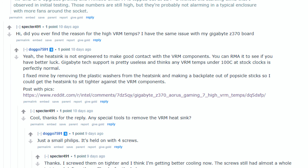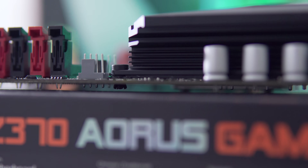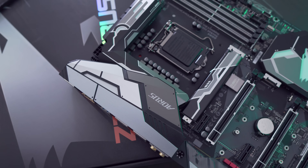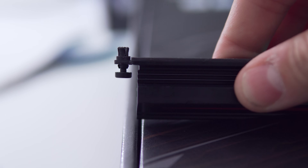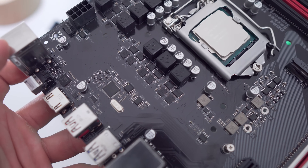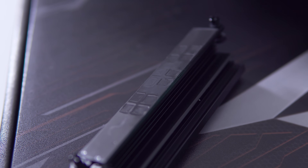I'll link that discussion thread in the description below, but the basic idea here is that the VRM heatsinks are just not making a tight enough contact to the MOSFETs underneath, and this results in very poor thermal conductivity. Before we proceed, do note that you'll most likely be voiding your warranty here, and I am not liable for any damage at all that you inflict on your board. As the boards ship right now, the washer between the heatsink and the motherboard actually restricts the tightening between the heatsink and the MOSFETs, which means that the thermal pad underneath the heatsink does not fully encapsulate the MOSFETs like they should, but only lightly presses onto them. This is fairly evident when looking at the very shallow imprint that the MOSFETs actually make on the thermal pads — they definitely should be a little bit deeper than this.